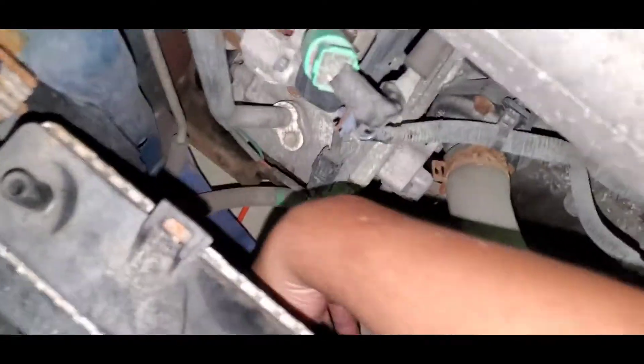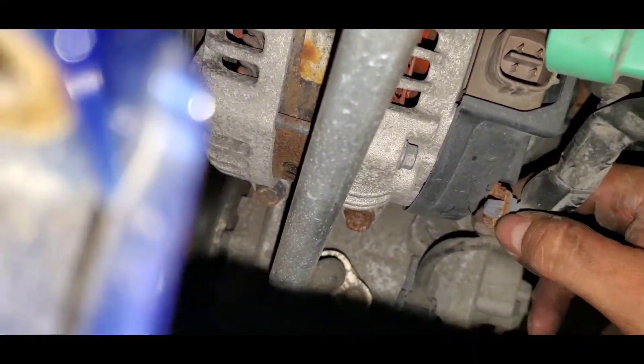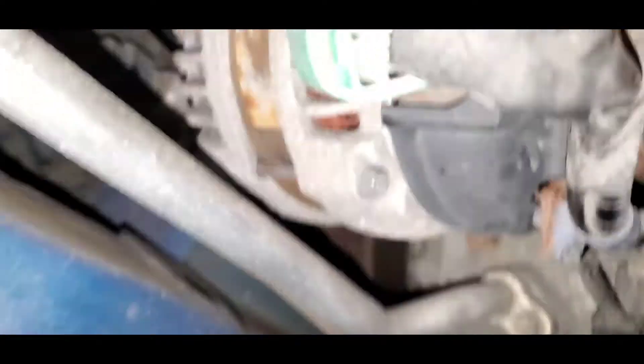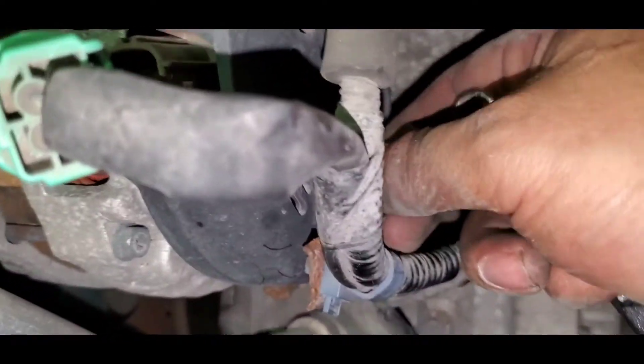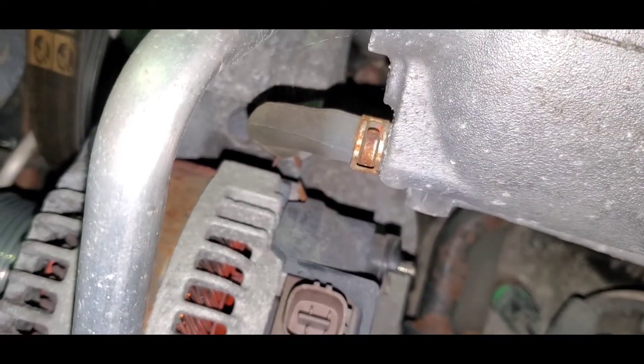Stick my hand in the back way — it's hot. Can we move this bracket? There's a really tiny bolt — I'm just going to remove a bracket that holds this thing right here. It's an eight millimeter. And then we can just pull it out. I just removed this bracket — it's an eight millimeter — and now it should come off. Now we can get to the bottom bolts right here. We'll see if we can put it on the other alternator.